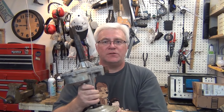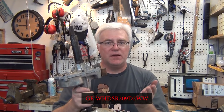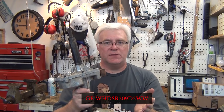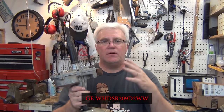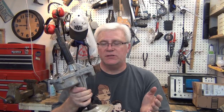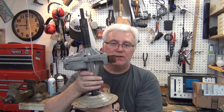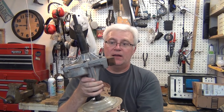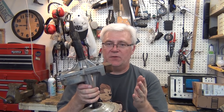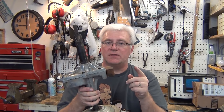I have a friend who has a GE washing machine and it was making noise in spin cycle only — just a wrecketty-racketty mess noise. I went over it, tore it apart. Sure enough, the bearing at the bottom of this brake assembly is bad. Nothing else is wrong with the machine, but this brake assembly transmission, you have to buy it all or nothing. This is not engineered to be serviced in any way — it's pressed together and crimped, so there's some things to tackle.